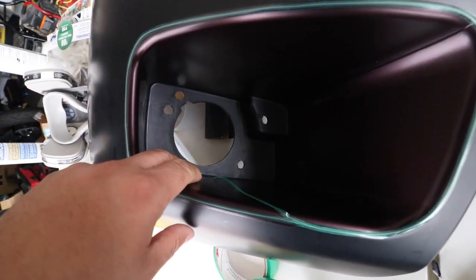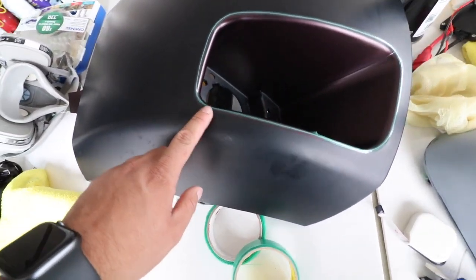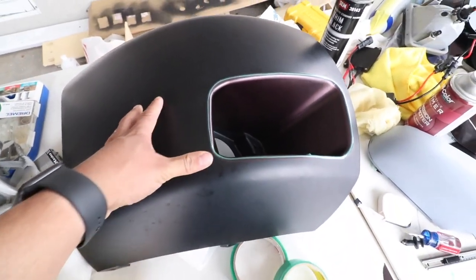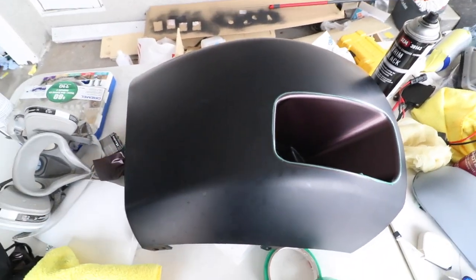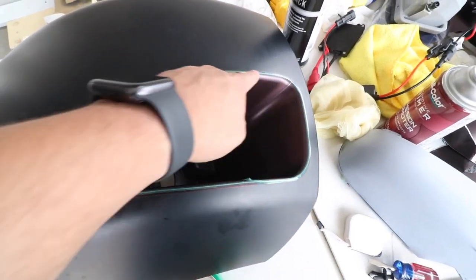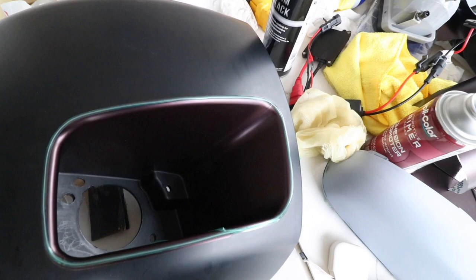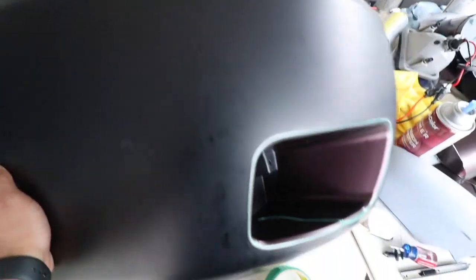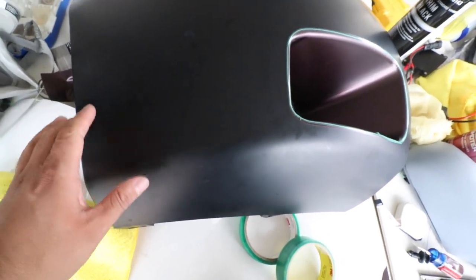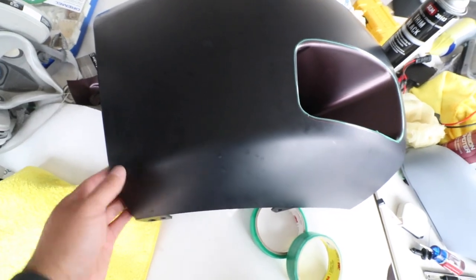All right guys, I laid my inlay already in here and I put some knifeless tape around it again. That way I'm gonna attach this to the truck, screw it on, and wrap the whole panel here. Once I get to this area, I can just easily take out the knifeless tape. Is she ready? This is that smooth plastic, so I'm not scared of the tackability, if that even makes sense. Or the vinyl. Should have worked perfectly well.